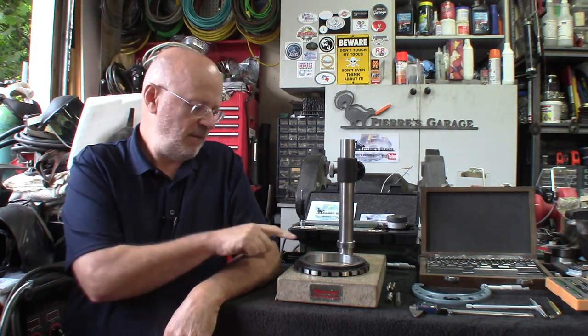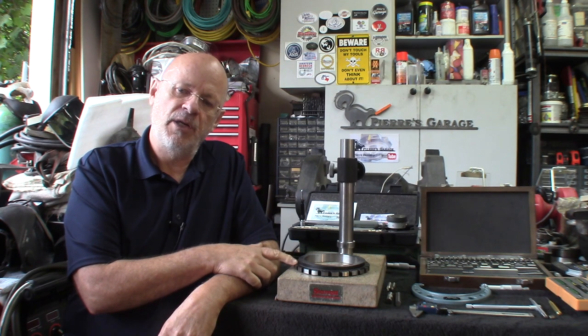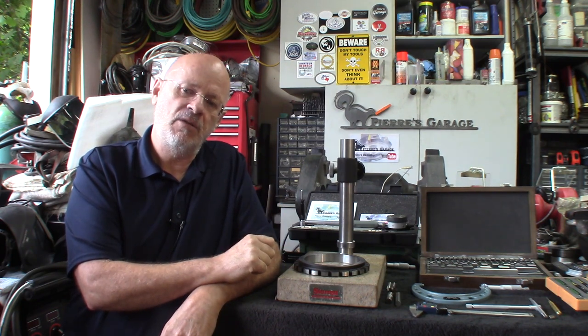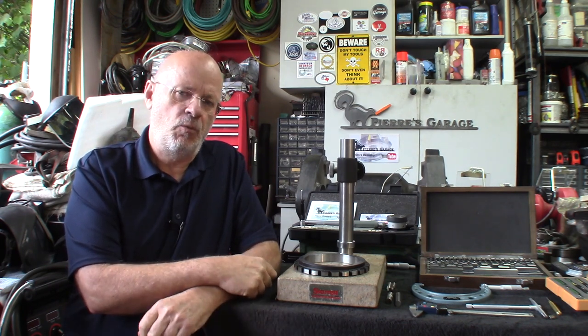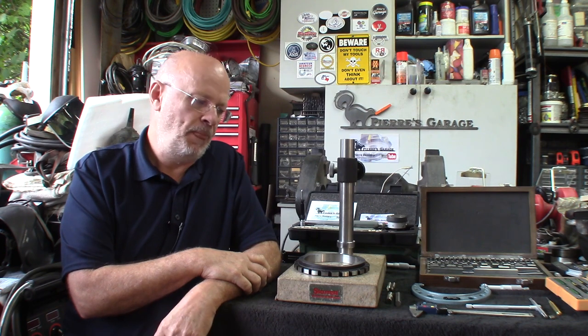We'll see that. But before, we got to make ourselves some kind of a reference diameter, inside diameter. As we all know, it's much more difficult to measure inside than outside diameter. And we'll try to get imaginative ways that without spending thousands of dollars, we'll be able to measure that within maybe 1 or 2 tenths of thousandths of an inch, which is some kind of a good achievement if we can make it pretty reliably.